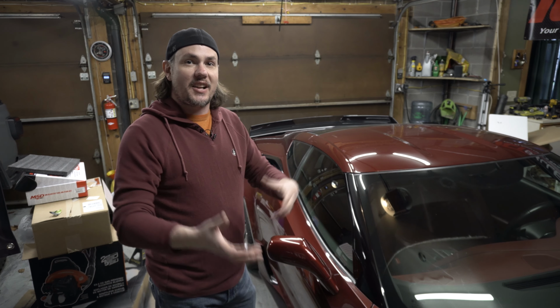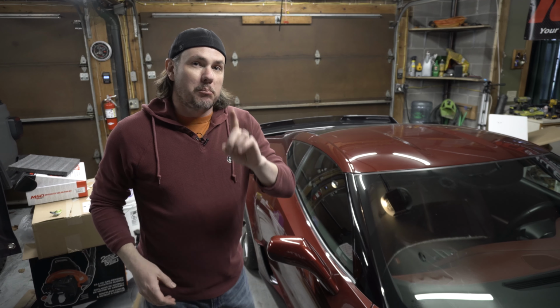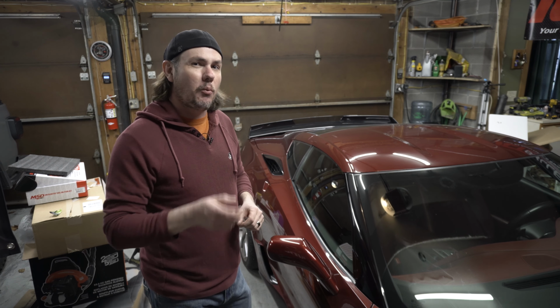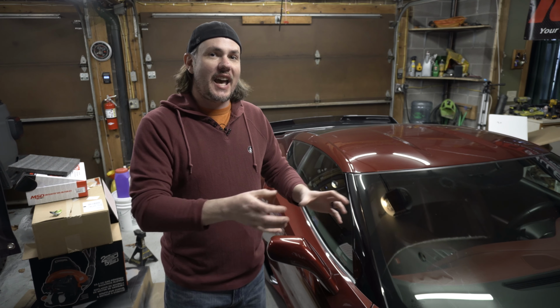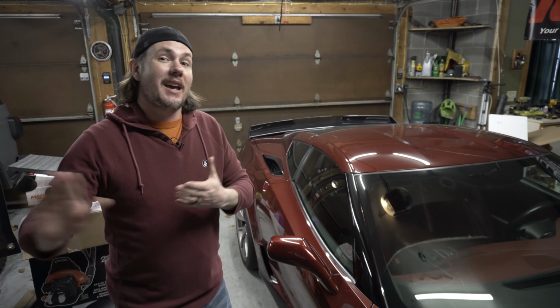You've gotten the front cats out of the way. The top manifolds are easy to get to, but there's 3 bolts on each header manifold for the heat shield. Go ahead and take those bolts out. I wouldn't worry so much about trying to get the heat shield out of there, because it's a very tight fit on both sides while the header and the heat shield's in there. But you'll notice, once you get the heat shield and the header unbolted, that you can actually drop the header out the bottom and push the heat shield up, and then pull the heat shield out the top, and the headers will come straight out the bottom and clear everything.